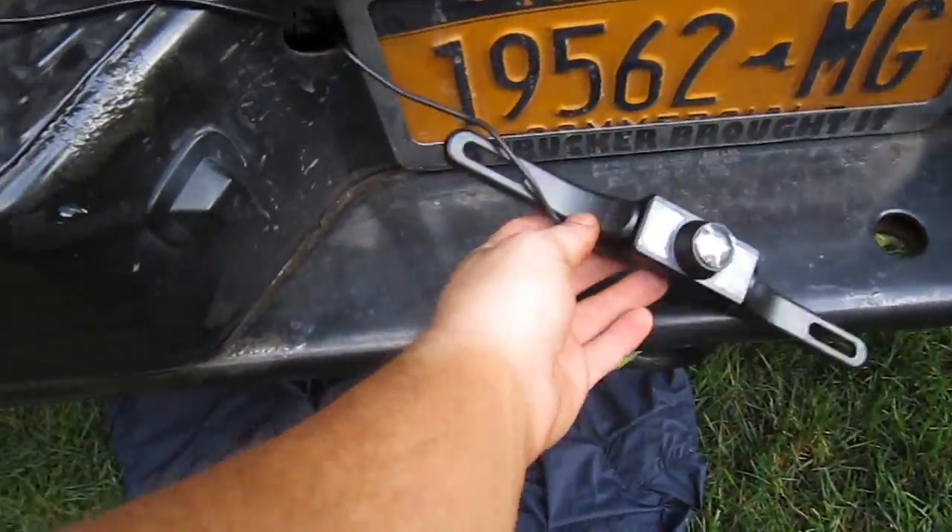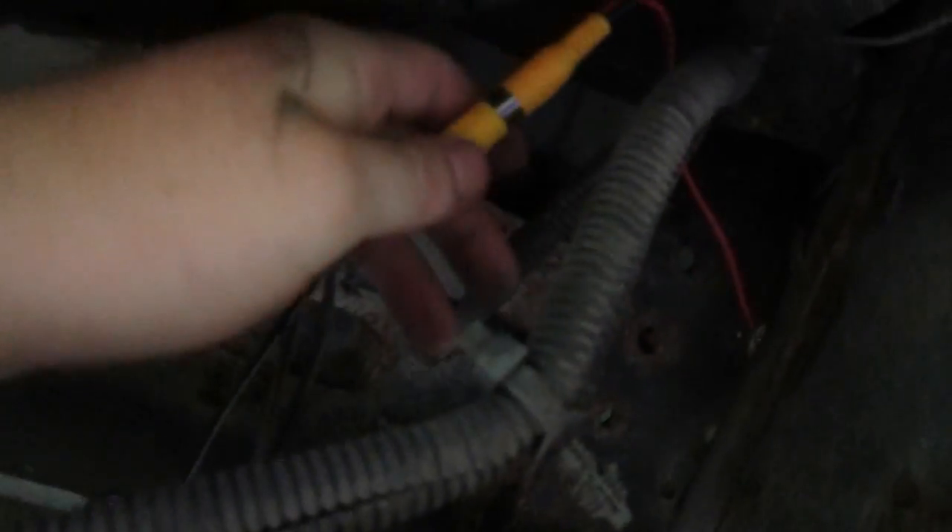So we got the backup camera — I positioned it on the rear. I connected the wiring. You got the round plug. You got the other parts under the vehicle right here. Before I'm done, everything's getting wrapped. So I ran this wiring, I'm running it under my truck. I run it next to the spare tire and the frame. It's going above my leaf springs.